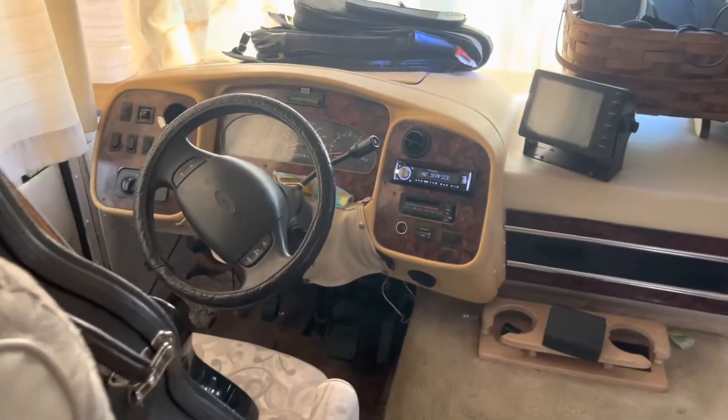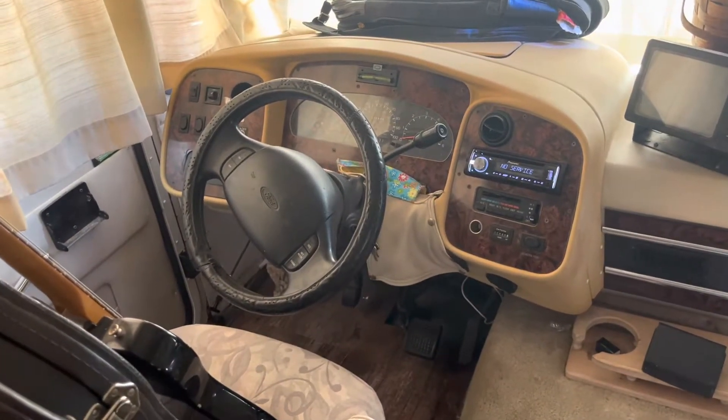I am excited that I didn't have to have a mobile mechanic come out. I fixed it myself, and it's something you can do for yourself. If it's something you can do on your own with just a few tools — some contact cleaner, a wire brush, and some sockets — crawl up underneath that RV and follow back from the battery like I did. Start with the battery, go to the terminals, and follow the terminals back to that junction box.